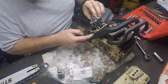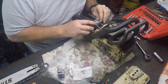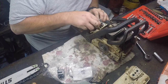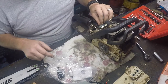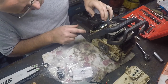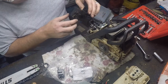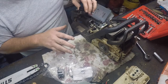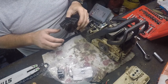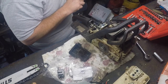Where this carburetor sets, these holes here — I tried opening this one up at one point because I was looking for the adjustment screw. Let's get this out of the way — there we go — and slide this on like so. Now we can see that it's actually this hole and this hole, and then this little tiny one down here. So we're going to have to open these up — basically drill new holes, or bigger holes as the case may be — which is fine, because the air comes up through here and then goes down through here, so any holes we open up here will be okay.